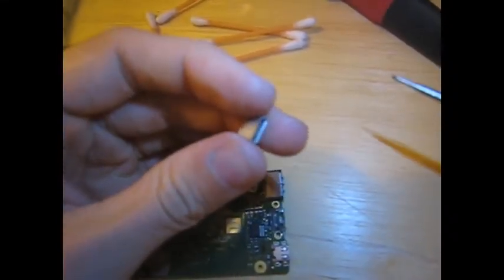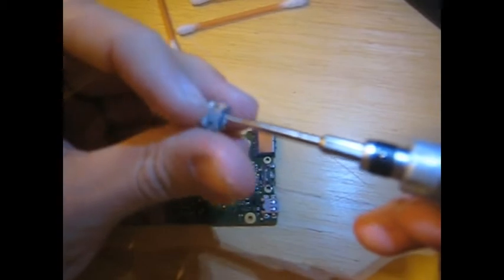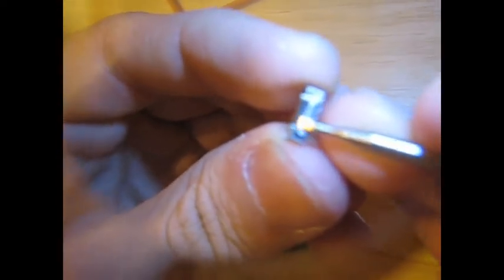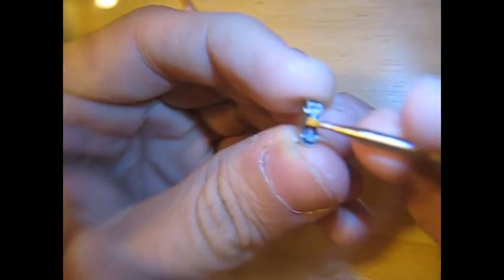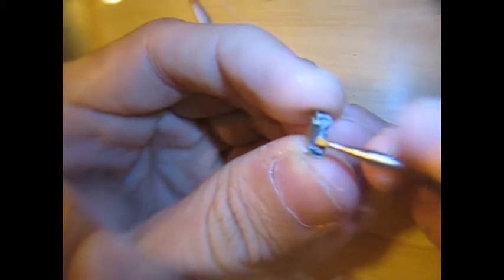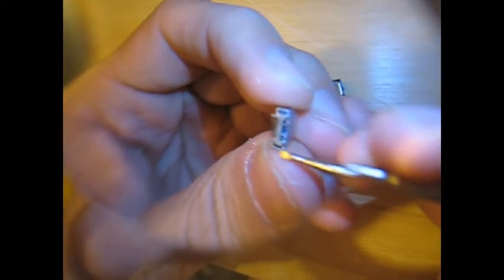Here's the new USB port. Here's the entrance — this is the top of it, here's the back. On the back there are pins. What I did was I took a screwdriver and pushed the pins up just a little bit, so that when I go to put it on the board it'll actually make better contact — it'll push against the contacts rather than just resting upon them. So when I put this housing on the board, it'll push the pins back and make a stronger connection.